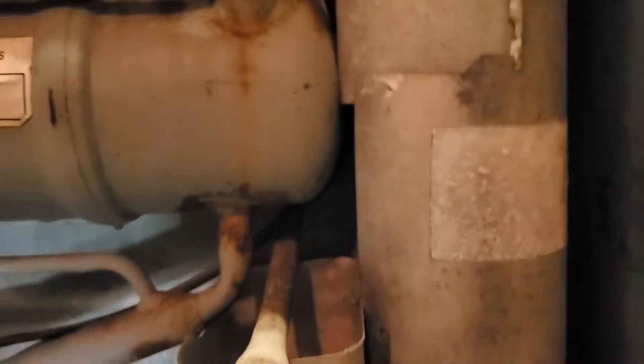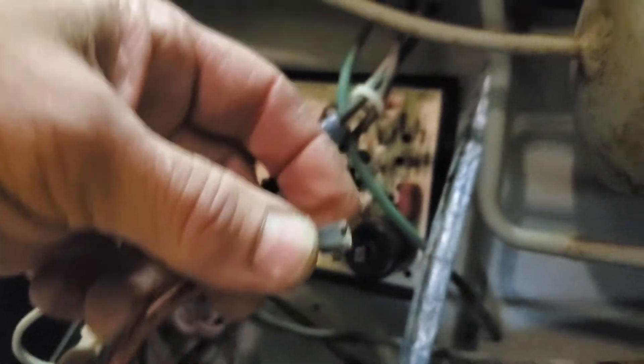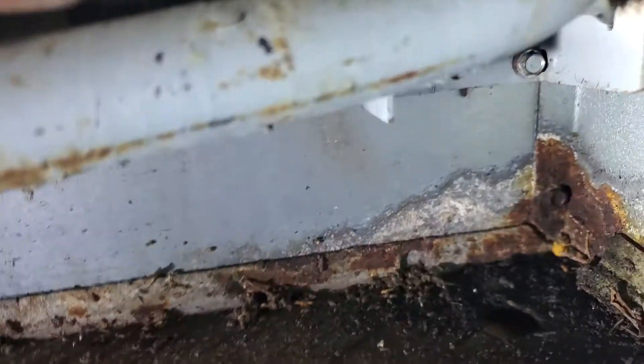That's my attack cat — get over there. All right, I'm gonna turn the camera around. There we go. So the igniter is right there. You pull that off — it's a female spade terminal — and then there's a screw. Hold on, it's got a little bit of a tilt to it.